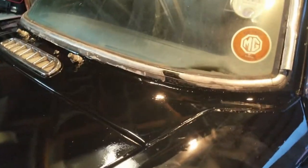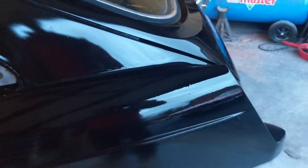I'm a little bit disappointed by this. Where I've used the tape you can see a nice clean line along here — that's proper car paint masking tape keeping the paint off. Where I haven't used it, for example across the top here, we've got leakage through. In fact where we had two coverings over part of it we've got a different colour. We've got some leakage through here too, and I think all of my windows — which I had covered with paper — probably have a thin film of black paint on them.